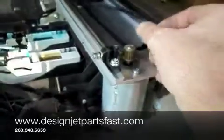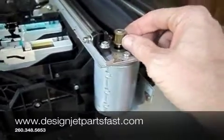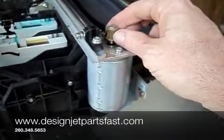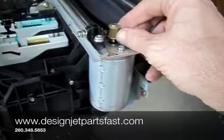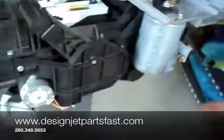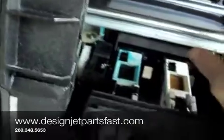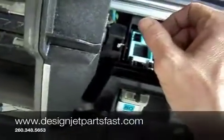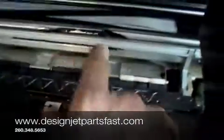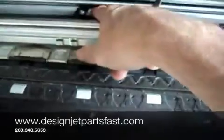When you're replacing a belt, it's very common to have ground belt residue in the head of your motor. I use a small flat screwdriver and just pry out any debris that may be in that motorhead — this one looks fine. Also, when I have the carriage off, I clean the rail front and back of the residue with a damp paper towel. Just water is all you need. This one's got a lot of ink — water is really good for cleaning up that sort of stuff. This is the trailing cable back here.